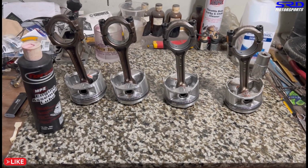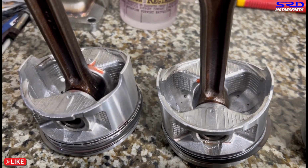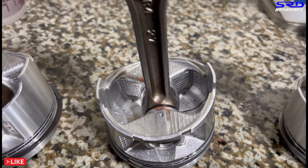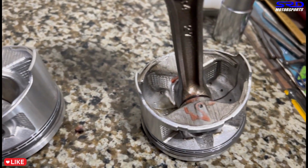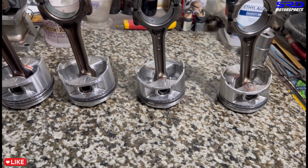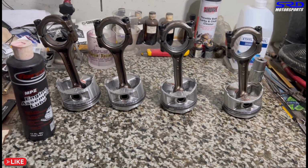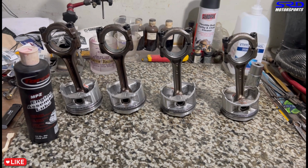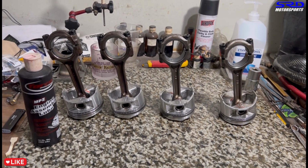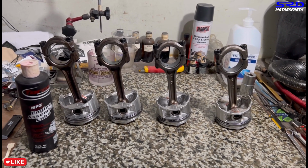And also this one here, on installing the pistons, we make sure the piston pin boss and the rod small end, be it stock or aftermarket, are well lubed with assembly lube, because they get lubricated by oil pressure and oil splash. So when you think about it, on an initial startup, that's not really oiled well. So it's going to gall the piston pin. If it's galled, it's no longer smooth. Do you think that's going to be spinning well? Nope, it might be robbing horsepower, right? It's just like having your wheel bearings not spinning smoothly is going to eat up horsepower.